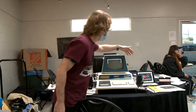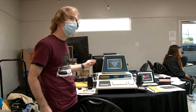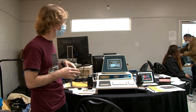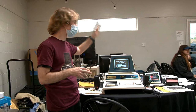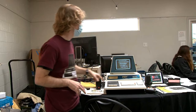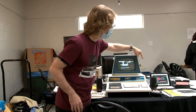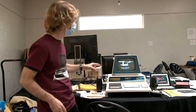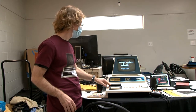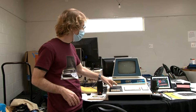I had problems with chips with broken pins and all sorts of problems — ROMs were not working right. And then the monitor went screwy, with waves, and the capacitors went bad. This part was relatively easy, just changing out electrolytic capacitors in the video circuit board. The tape drive needed a new belt, but otherwise it worked.